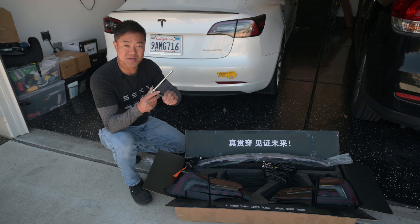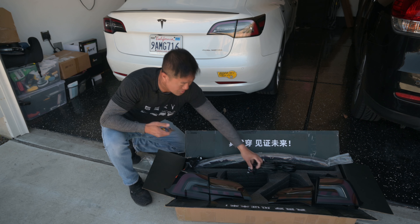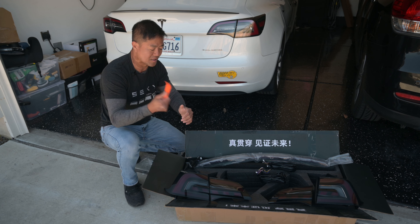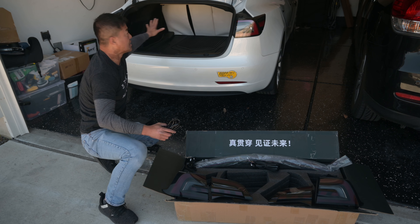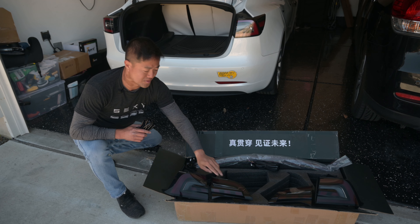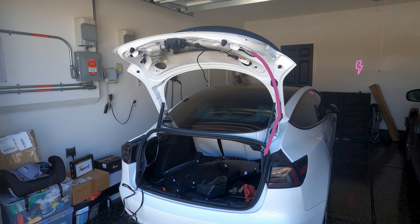Alright guys, you're going to need an 8mm socket wrench. You're going to need a little cutter because it comes with black zip ties to zip your wires against your car — once you tie it, just cut the end. That's all you need the cutter for. And also you're going to need this little plastic tool to pull out the taillight — it's made out of plastic so it's not going to scratch it. So the long cable is going to connect to the taillight in the back, and then it's going to go all the way to the rubber grommet area right here. It easily comes off and goes up towards your trunk area to connect to this connector. The next smallest wire is going to be on the right side and go all the way to the top of the trunk to connect to that wire.